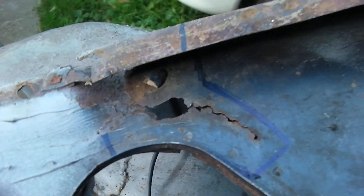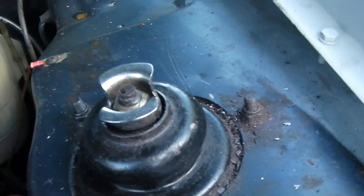I've zoomed in for some reason. This section here — I've got another door post where all the top bit is rotten, so I'm not too bothered about losing the bottom. I'm going to repair it here and here, as you'll see on the other one. I'm going to take it off and show you now. I've also got to repair it here — marked it off where I'm going to cut it. It's going the same as the strut top — just a few little blisters, so I'm going to chop that all out and plate it up. That one's solid.